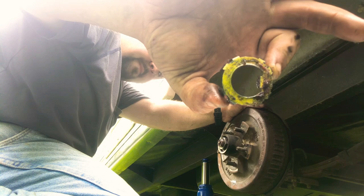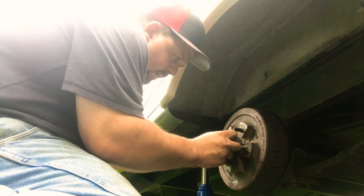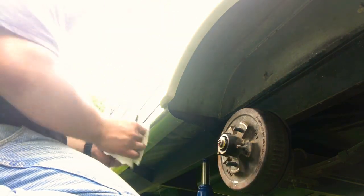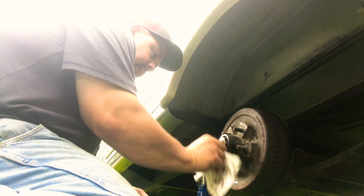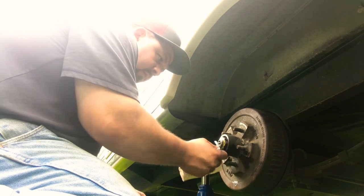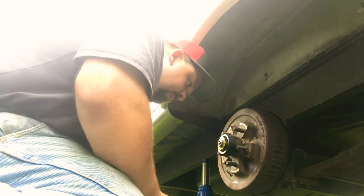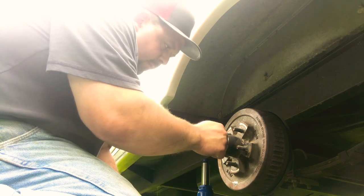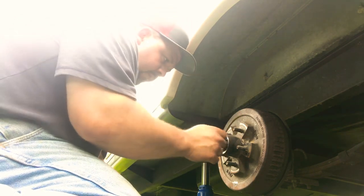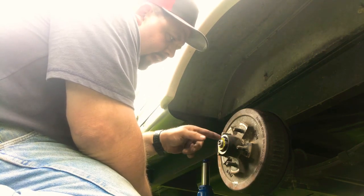Once that's done you take your keeper pin — there's a little flat spot here with a little tab that lines up on the flat spot here and this snaps right over the nut. Most RVs, the only one I've seen that uses this keeper style is Jayco; everybody else has a cotter pin. This one doesn't appear to be set up for a cotter pin, probably because of the zerk fitting, but I remember zerk ones that had the cotter pin offset to the side so you could still shoot a cotter pin through, bend it back or fan it out, and that locks the nut so it can't back out.